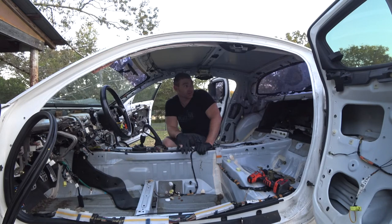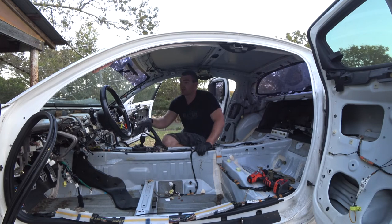The wiring harness I'm going to leave for right now. Obviously we don't need the stuff I've mentioned — the airbags, the stereo, any of the sensors or buttons for things we're not going to use. I won't be pulling those out until we have the new engine, the new ECU, and the new wiring harness, so that I know what I need from each to control the engine but also have ABS, taillights, headlights, all the engine controls, and possibly the gauge cluster. That concludes the interior so far.